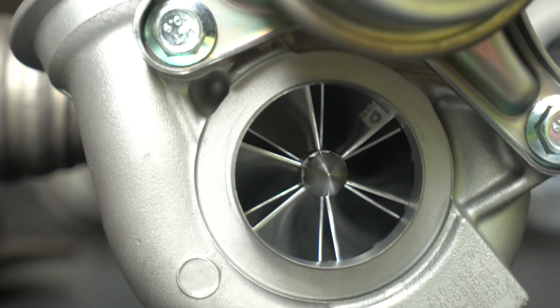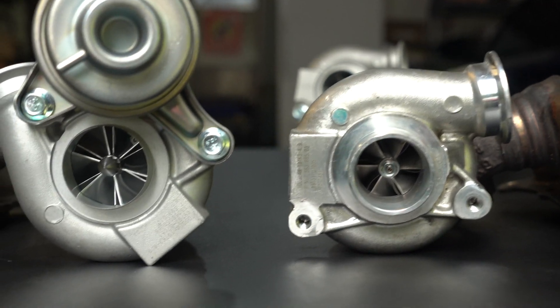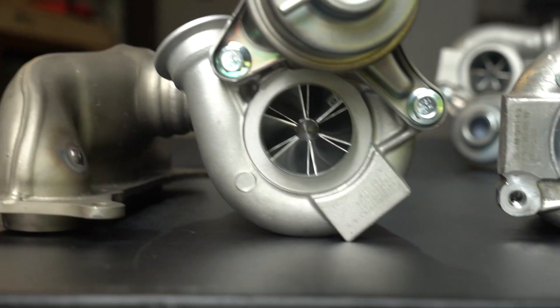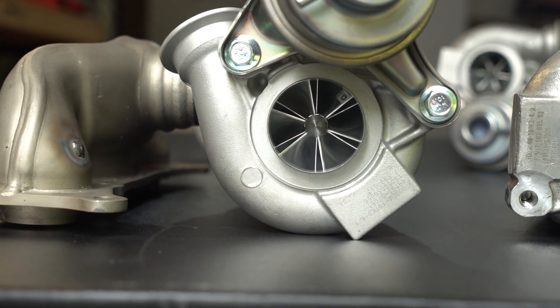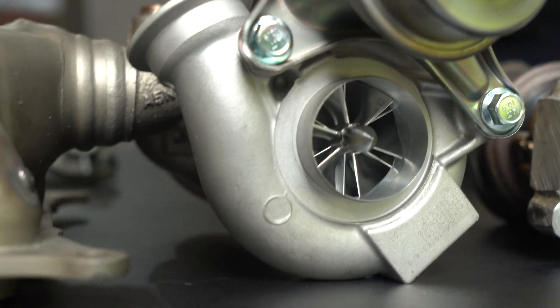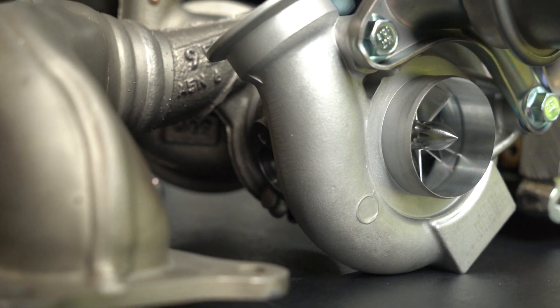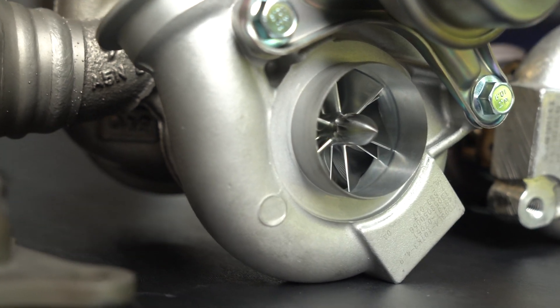Note that these are not the two-inch high flow version of the Pure Stage 2. They do offer a free upgrade that has an extended two-inch snout, and the benefit of that is your inlets aren't going to slip off quite as easily and you get a little bit more airflow.